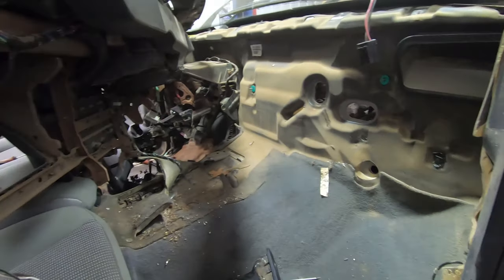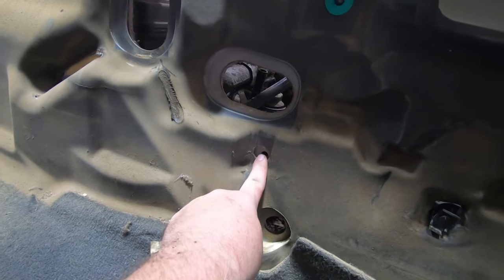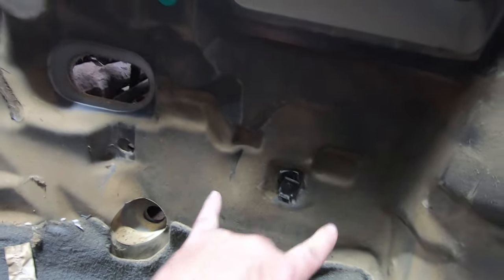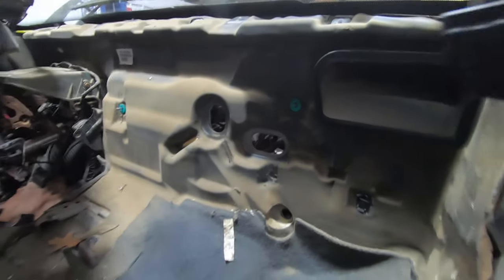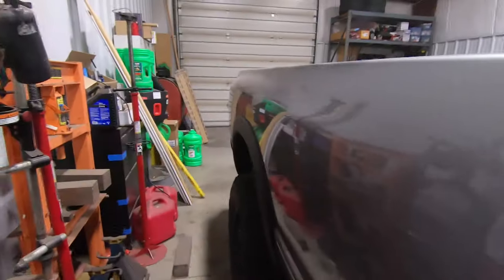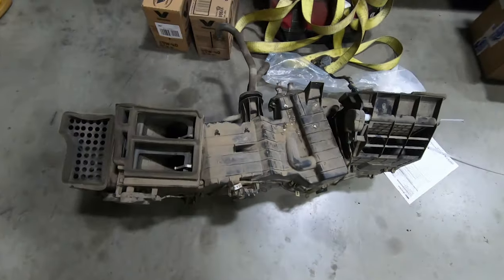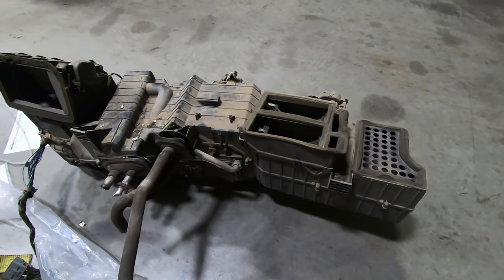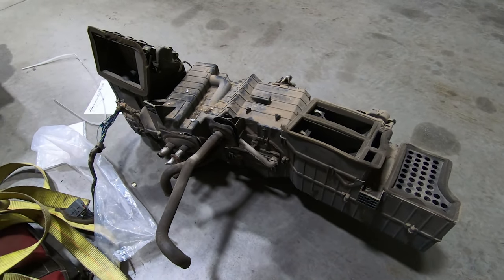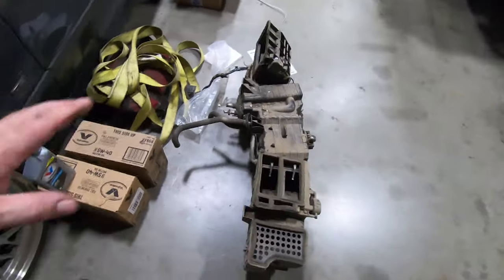The box is out. There's a nut here, bolt here on the firewall, another firewall nut there — two underneath on the engine bay side and three on the interior, and it just pops right out. Luckily it only weighs about ten pounds. This would be the firewall side. We decided to take it apart with the hoses on the heater core because they didn't want to come off. Pretty simple — now we're going to tear this entire box apart.